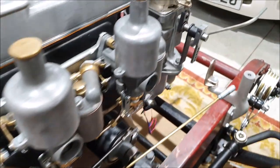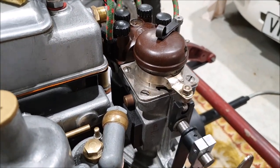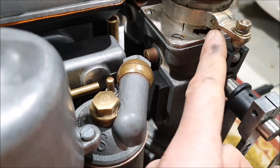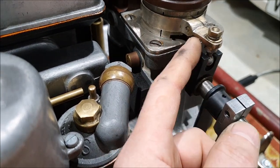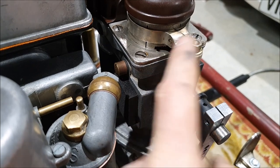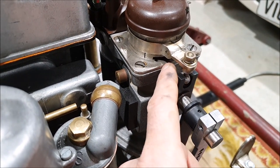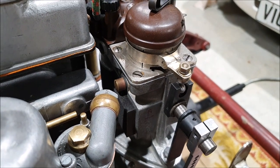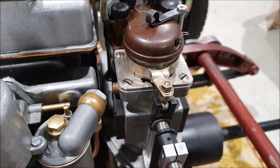Then I was able to rotate the engine by hand with my fake starting handle and check where the points are opening. I already knew where the top dead center point is when this sparks and starts — you may have seen my earlier films where I was having trouble getting the engine to fire the first time, because with everything in the most retarded position it wasn't actually sparking. So I had to have the lever set forward a little bit, and I set that as my maximum retard position — effectively zero degrees, because it's at top dead center. Then I worked out where about 30 degrees was to give me a figure to work from.